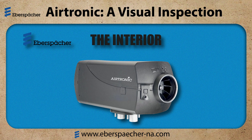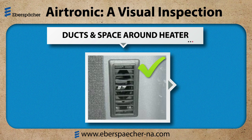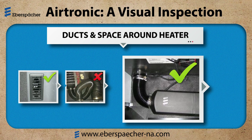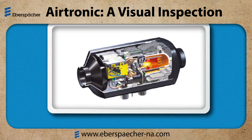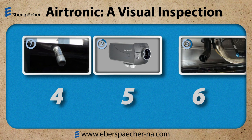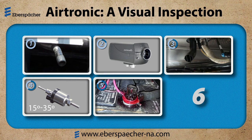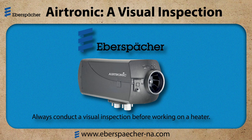That takes care of the outside inspection — now we will check the space around the heater. We need to look at the vents and all ducting for damage and routing, then the heater mounting and space around the heater. There should be nothing on or against the case. For this quick visual inspection: first find the exhaust and follow it to the heater, check the combustion air intake, then follow the fuel line to the pump and then the tank. Check the harnesses, then get inside and check for space around the heater and all the ducting. These items are often overlooked and contribute to heater issues. Always conduct a visual inspection before working on a heater.